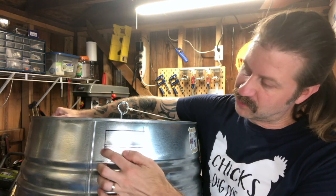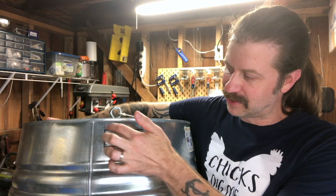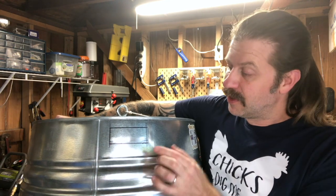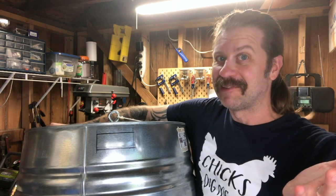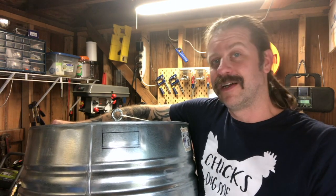The first thing we need to do is figure out where we want our preamp to go. I want to put mine right here — you can see I drew a box on the metal and that's what I'm going to cut out, and that's where the preamp kit is going to go. For mine the size of the box was one and a half by three and a half inches. Go ahead and measure yours because you might have a different one. Then we'll use a metal blade on a jigsaw to cut it.